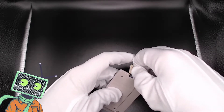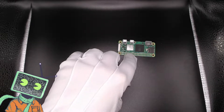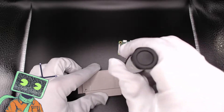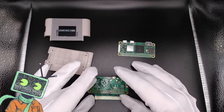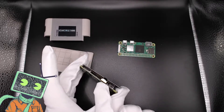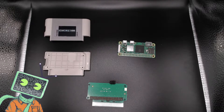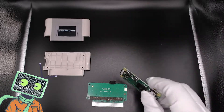Let's go ahead and get into taking apart the device. Start by getting the SD card out of the back. Flip the cartridge over and on the back we have four screws — remove those to take the cartridge apart. Now that we've got the cartridge apart, you should be left with the Raspberry Pi Zero 1 along with the Retroflag chip that makes it all work. It's plugged in up top by a plug and a thin ribbon cable — be very careful with that when removing it. Once removed, we're left with the Retroflag pin. Here are the 40 pins that connect to these 40 pins here.